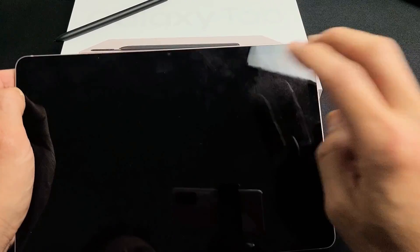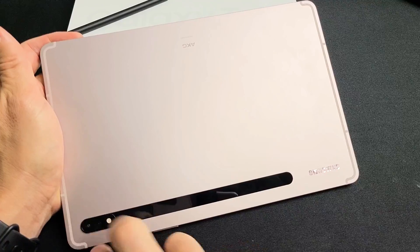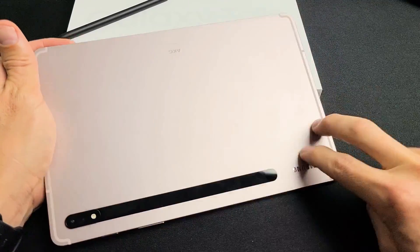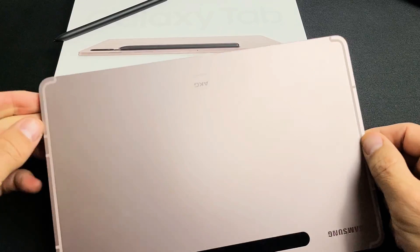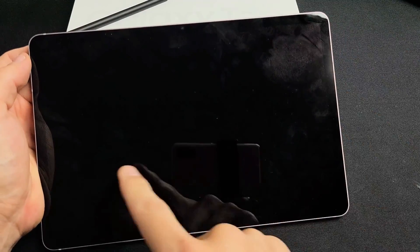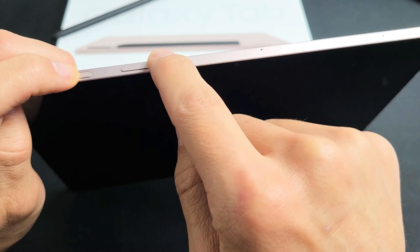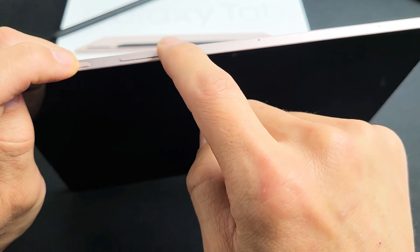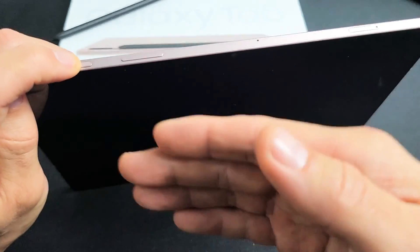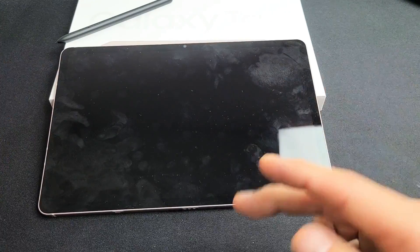Keep on tapping. Now do the same on the back — two fingers, tap everywhere, even all around the camera lens. Then go ahead and turn over to the screen and see if you are out of the boot loop. If you're still stuck, no problem. We're going to force restart it again — power button, volume down. Press and hold both buttons and do not let go until you see the Samsung logo appear. This typically takes about 30 seconds. If the tapping method didn't work, we're going to go to the next possible fix.